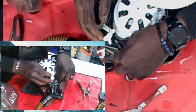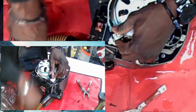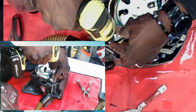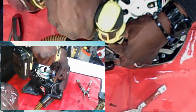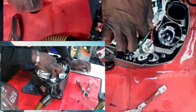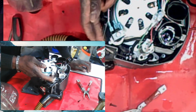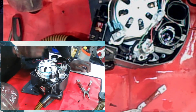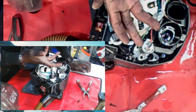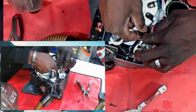So there's not much more on this particular topic of spraying that I haven't covered in the past. This is really to give you an idea of what the job of these things is. What are they supposed to be doing? Because replacing them, honestly, is just unscrewing, plugging back in, and also understanding what to replace. If you're going to replace the pump, replace the solenoid. Okay. If you replace the pump and the solenoid, and something is still going on with the function of the pump, where it's a brand new pump, what the hell, right? Then this thing might need to be replaced, the rectifier.